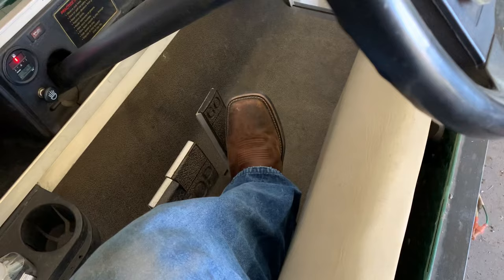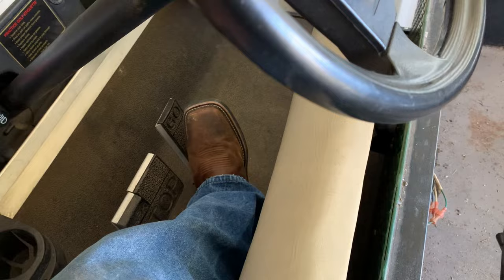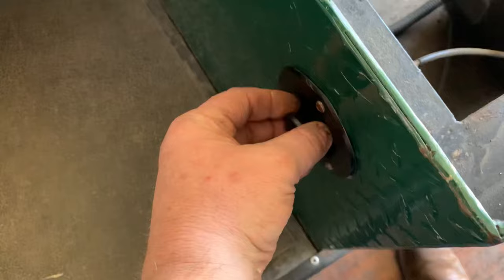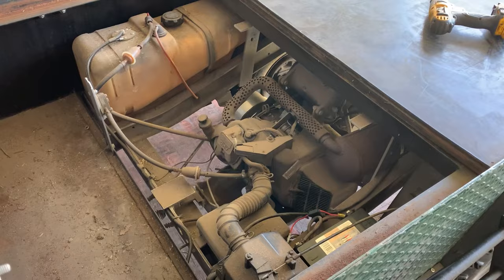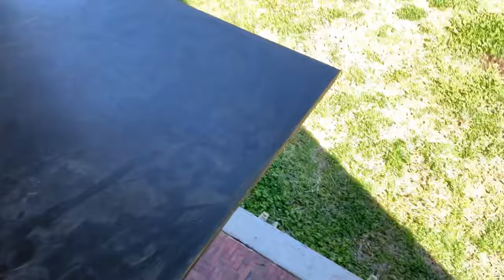The key switch is on and whenever you hit the gas pedal it starts the motor spinning over. When you let off the gas it kills the engine. What we're going to do is get it cranked up at wide open throttle and then check the charging voltage to see if it's charging the battery. You can invert the seat sideways and make sure it pushes down on your gas pedal. Give it a little choke if you have to — that should be wide open throttle. Let it charge just a minute while I go get my voltmeter.